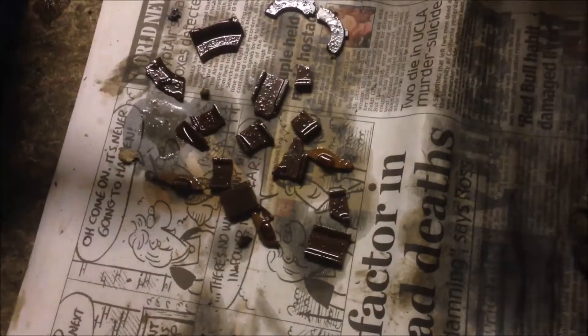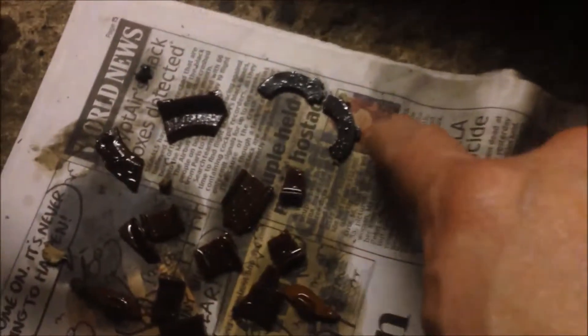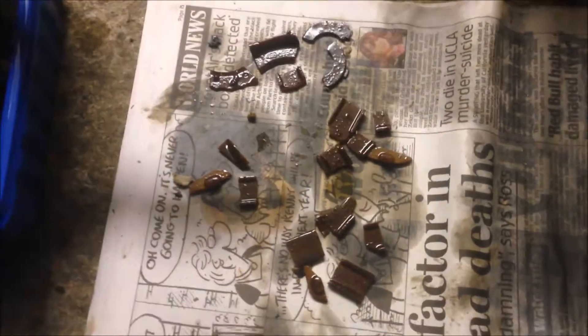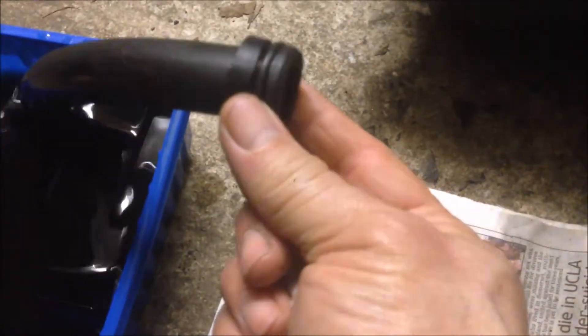You can see all these pieces I removed from the strainer — they were blocking the inside. I think they're all from the timing chain guide. These two pieces are black plastic and all the others are kind of brown. I counted five, five, five, and another three — so 18 broken pieces of timing chain guide found inside this strainer.